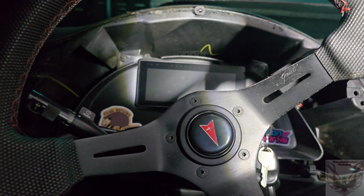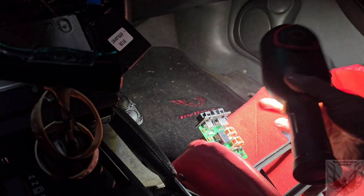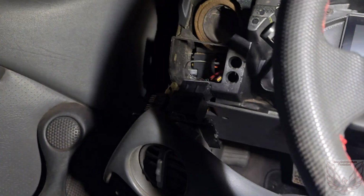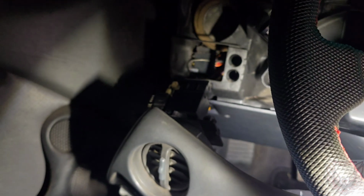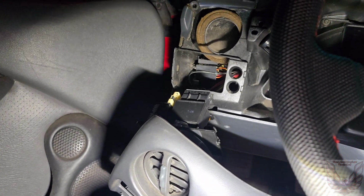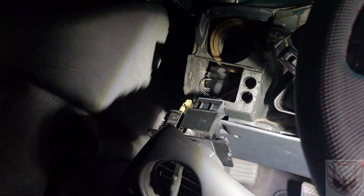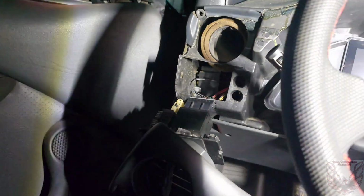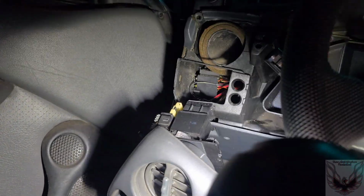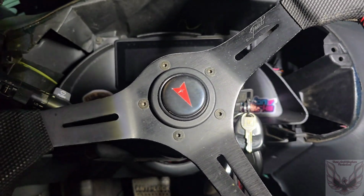So I bought a new daytime running light module. That one's out of its case. Its case is laying here somewhere. And I bought a new headlamp switch. The only reason I put a headlamp switch in it is because all the light wirings run through it, and I thought if it has an issue, that could be it. With the fog lights on and the car running, you could cut the key off and the car would almost stay running. Never understood that, but that's why I put a new switch in it. Either way, I got to swap knobs on the switch.